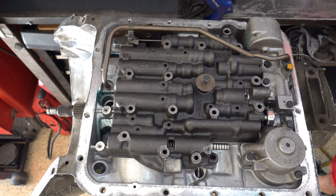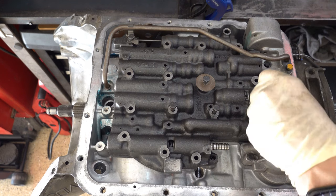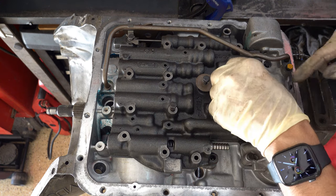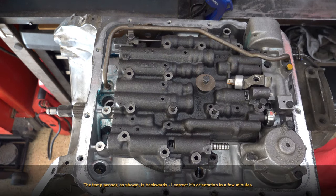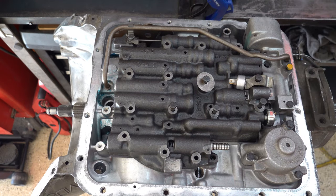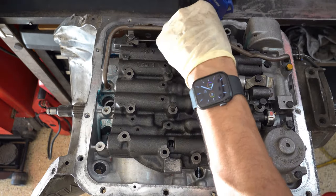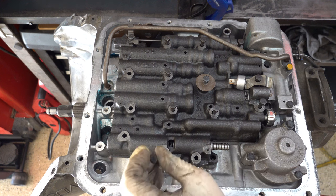Next I like to install the so-called golden bolt — this one actually just has a yellow bolt head. If you have a transmission equipped with a temperature sensor or transmission temperature switch, make sure that gets installed. How this works: if the switch detects trans temperature exceeding a certain threshold, it sends a signal to the PCM, which then locks up the torque converter clutch so temperatures can be reduced. It's like a safety mechanism, not too dissimilar from that TV check ball.